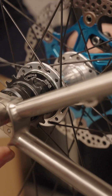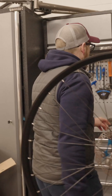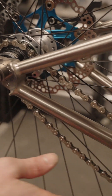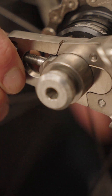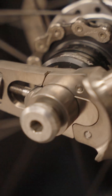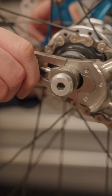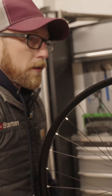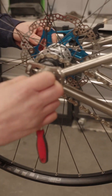Give it a little jostle through and effectively put it on a couple of threads. Next step is your chain — there it is, all baggy and loose. All we're going to do now is wind these little finger wheels. This one as well — it's nice. You don't want it too stiff, so you're looking to try and sit it as straight and in line as possible. Then your next step is to tighten up the axle — nice and tight.